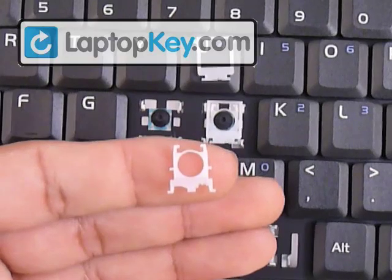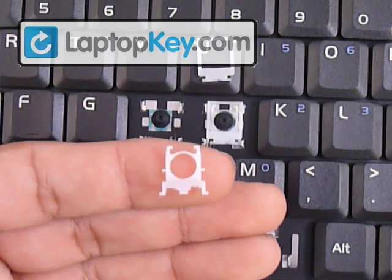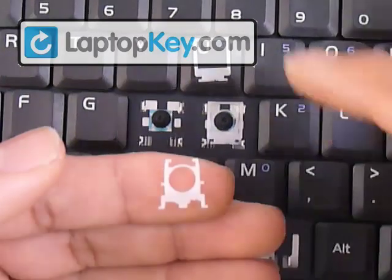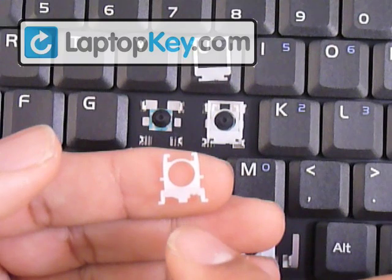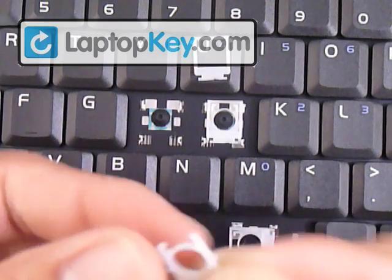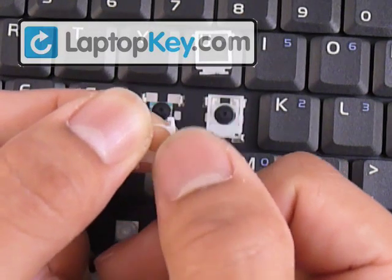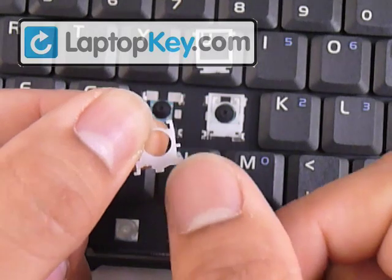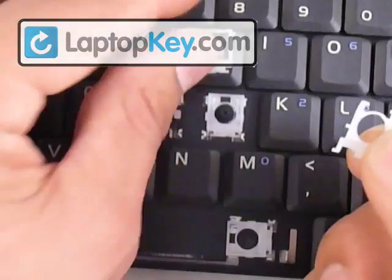Get the next hinge. You can see it has two pins going inward at the top — and again, I say top because that's where the large hooks are. It has pins in the middle that click onto the holes in the middle of the large piece, and pins at the bottom. Make sure not to put this piece upside down by feeling the entire area. If the bottom half is thinner than the top half, that faces away from the keyboard. If it's the same thickness from top to bottom, that side touches and faces the keyboard. Now you know the position for both pieces.